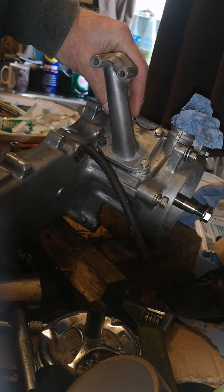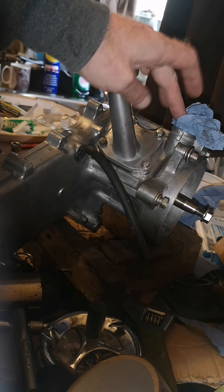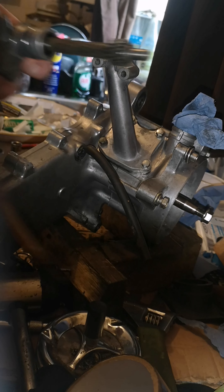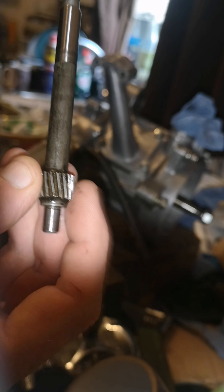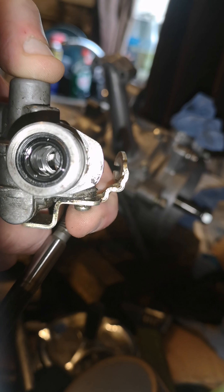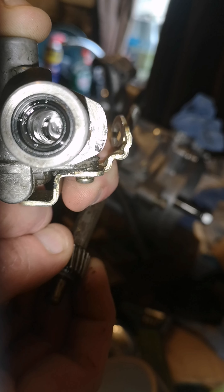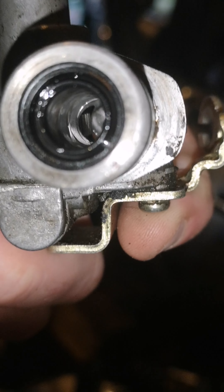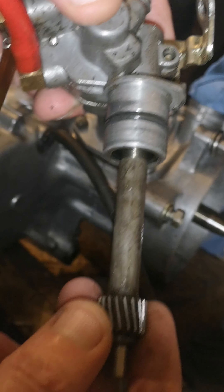So that's that on - the bracket's on this side for the cable from the magnet, though it might need to go on that side but I'll easily swap it over. Now we'll get the oil pump on. There's the oil pump - it wasn't rigged up on it. That's what drives it there - that bit drives off the crankshaft. If you look up there right at the very top on the left hand side you can just see a little wheel with splines on, looks like threads. That's what runs the oil pump - off that part that just slots in there like that. The crank's running that and it's turning the top bit.